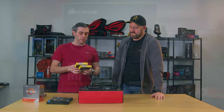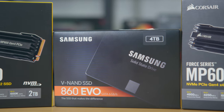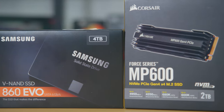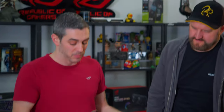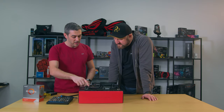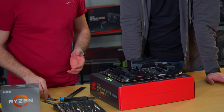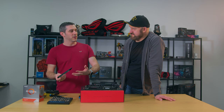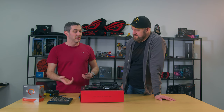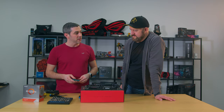SSD-wise, we have the MP600s from Corsair. Depending on your motherboard there are different areas they can go - sometimes up by the first PCIe slot, one down at the bottom; some boards have two slots, some one, some three to four. You can see we have two areas here, so one slots into here and one into here, with little standoffs because these drives come in various lengths. Gen 4 drives are a lot hotter than Gen 3 drives and that's mainly down to the controller rather than the chips themselves.